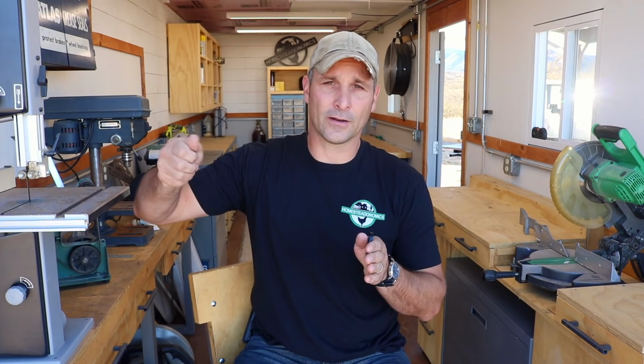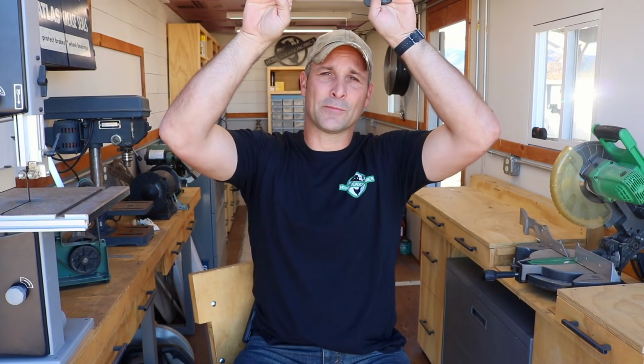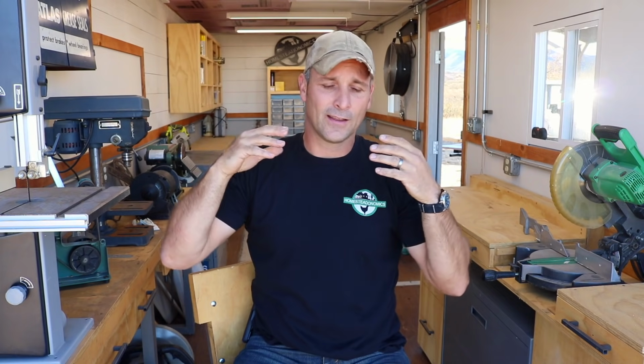After that, I will do the 12-volt setup, which will begin in the battery box, where I'll set up the battery, the fuse panel, the on-off power switch, and then run all of the wires into the trailer, and they will go up into that cabinet above the front dinette and then get distributed out to where I think the lights and power needs will be. And then after that, I will finish out the kitchenette area. I've got a good plan for that, so hopefully there won't be any hang-ups there.